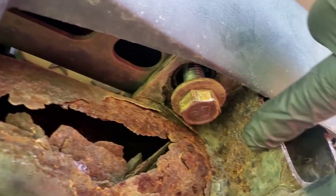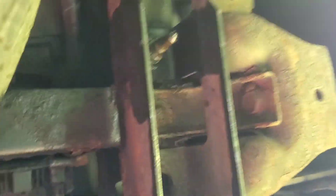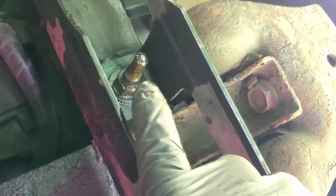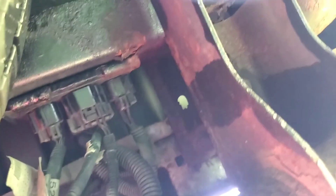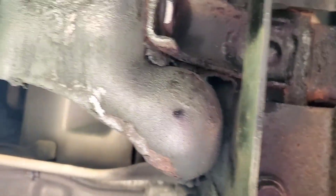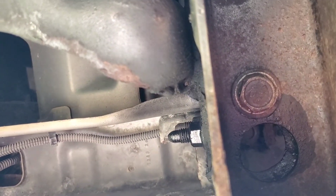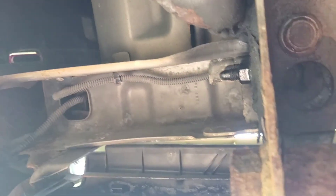On this hitch there are two bolts that tie onto the bumper, one on each side. Then there are three bolts on each side — as you can see, one here, one there, and one more. You just undo those bolts; you may need to soak them with WD-40 or a rust remover spray to get them loose because they'll probably be very tight. I've already taken off two bolts on this side and I'm taking the third out now — years of pulling and tugging have really tightened them.